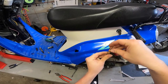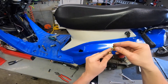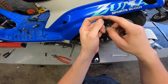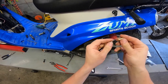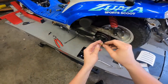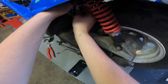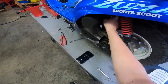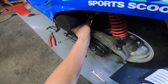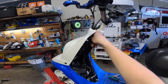You're gonna take this cable here, thread it into the cable outer. You'll take this cap, slide it over with the spring and the gasket. This knob plunger piece will go right on there — sometimes you will have to file this piece of solder down just to get it to slide in there a little bit easier, but nothing crazy. Then you'll take this whole assembly and drop it right into the carb. Finger tight — now we're gonna grab our wrench and get it nice and tight. The bottom half is set up.